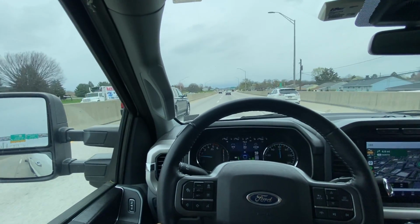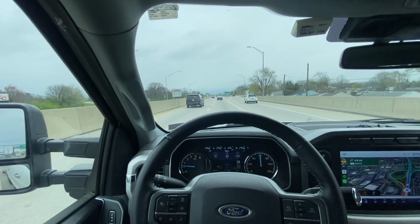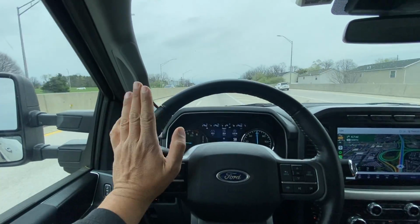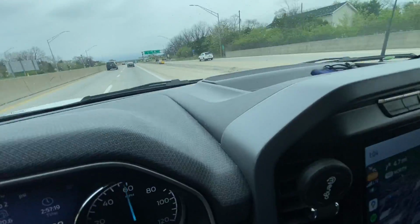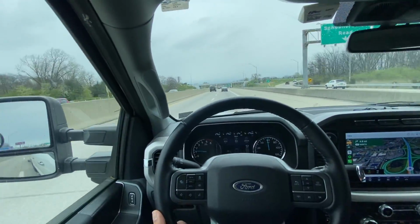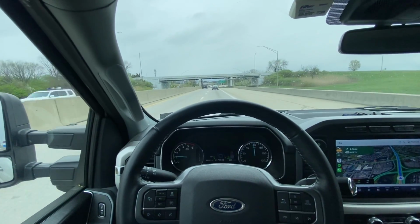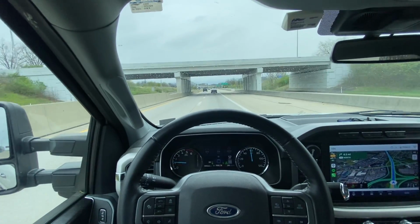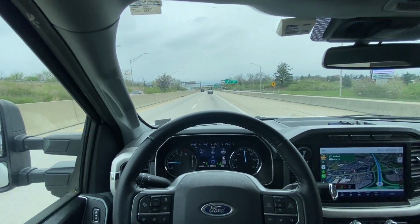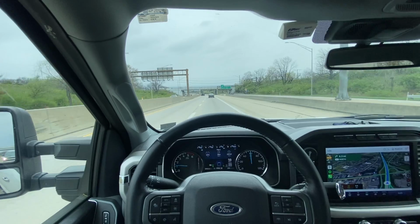But you're going to want to know what's the final drive in the F-150 that I'm thinking of buying. And if you're thinking of buying a diesel, which is a great truck in a lot of ways, largely related to that number in the middle there that you see, 20 MPGs with a trailer, if you have a choice in the matter, you might want to think twice before getting a diesel F-150 with a 331. I would absolutely recommend a 355 or maybe even a 373.